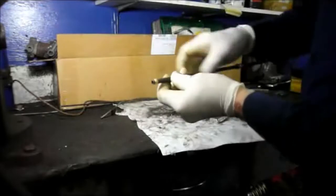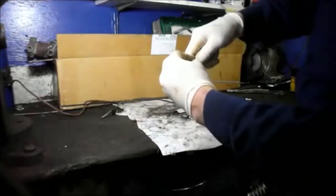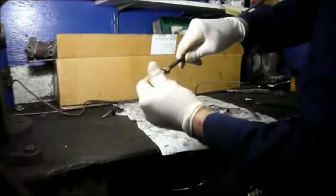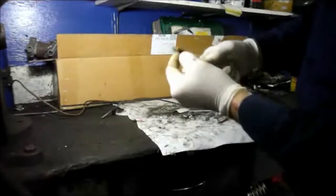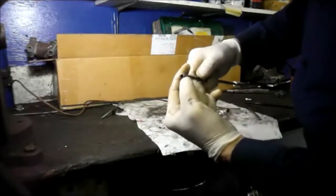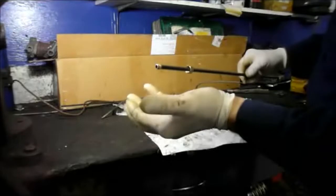When you put a coupling compression union on here and you join it together, the way it works is that it screws down over the top of the line. You put that little brass fitting over the top. This goes onto it like that, and you tighten it down. And what it does is this brass fitting right here crushes into the metal tubing, but by doing that it reduces the inside diameter. So the correct way to do a brake line is not to use these compression unions.